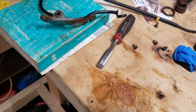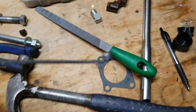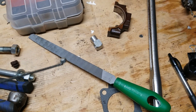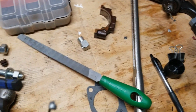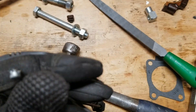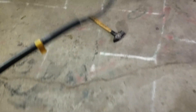Put the gas pedal aside for now. You're gonna run your cable through, and at this end you need to file or use a bench grinder to make this piece really small. I ground it as much as I could and finally I just took my pair of pliers with the cutting tool and cut it in half — it's still attached there. The reason is this little piece has to go into that little yellow fitting.